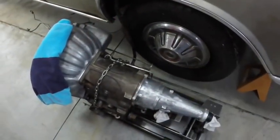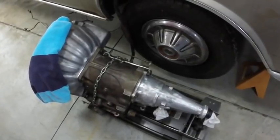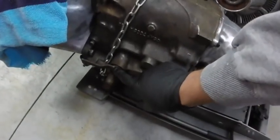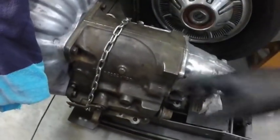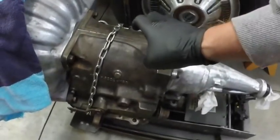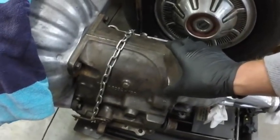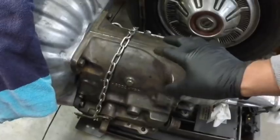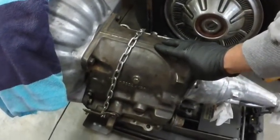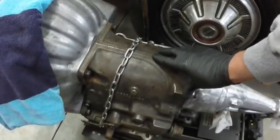While we're on the subject of parts, I did locate a rebuild kit for the transmission. It comes with the seals for the back, the front — all the complete seals and gaskets, all the clutch packs, everything but the bands. The bands are not available; if I need the bands I have to have them re-lined. But I think I'm just going to put the seals in the transmission and call it good. If it doesn't work I'll take it back out and go through it.